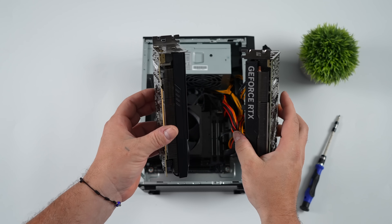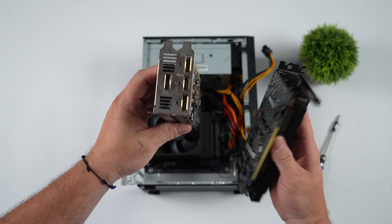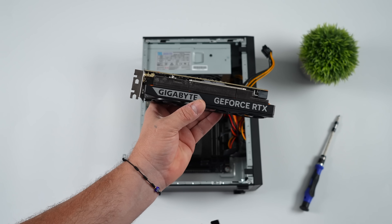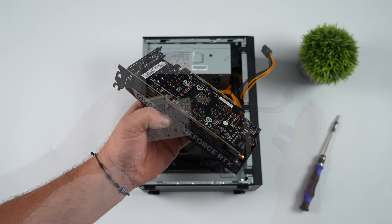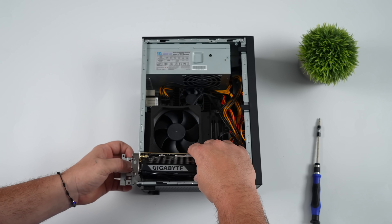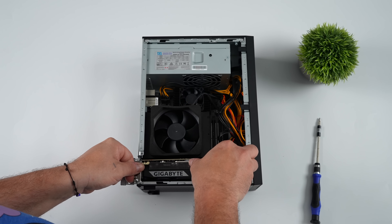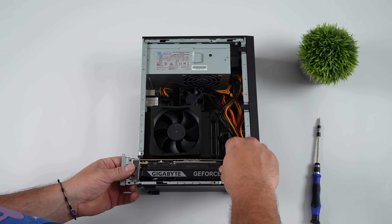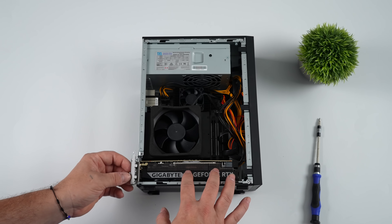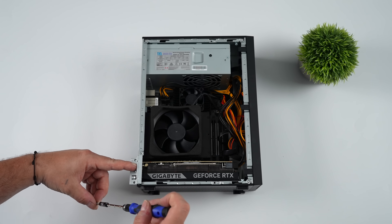The last thing I need to worry about here is that GPU. Just to give you an idea, these are basically the same exact form factor — left-hand side is the 5060, right-hand side is the 4060. So we shouldn't have any issues installing this in the PC. We've got that one 8-pin PCIe connector, so we'll go ahead and slot this right down in and snap it in. We're about done here, and I do have 32 gigs of DDR5 installed. This will run up to 5200, but it's 5600 megahertz RAM. I was kind of hoping we could overclock with the X3D, but we're limited to 5200 with the board we have here.